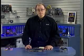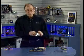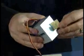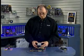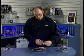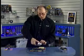Now the processor is firmly installed in the socket and we can install the heat sink. The heat sink that came with the boxed AMD Athlon XP has a piece of removable material protecting the thermal interface material — peel that off to expose it, which helps transfer heat between the processor and heat sink. Notice the bottom of the heat sink has a contoured raised portion that must line up over the raised part of the socket, so it has to go in a specific direction.